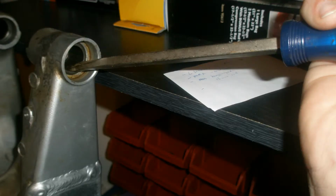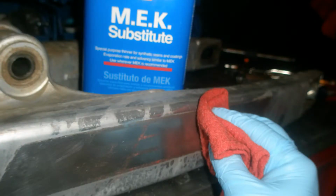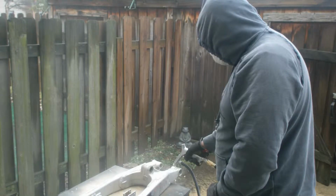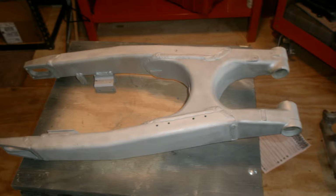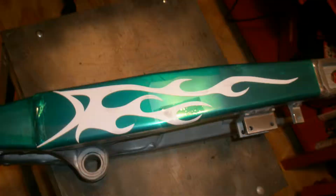Well, first we had to dig out those old bearings. They were the originals and came out in pieces. Next I removed the stickers by using a heat gun, but that left a residue which required some MEK and a bunch of clean rags. And then I sandblasted the entire part by using low pressure to keep a smooth surface to allow for polishing. After polishing both sides, I laid down a layer of high heat tape, which is required because of the baking and the powder coating process.